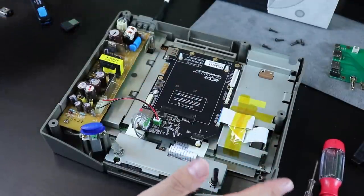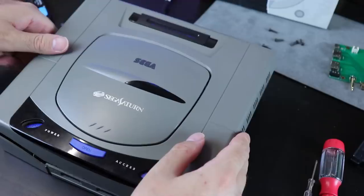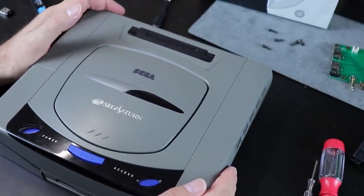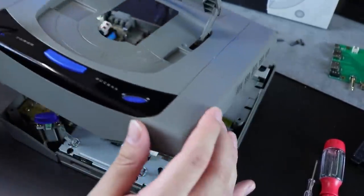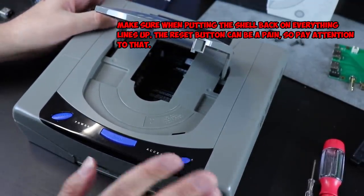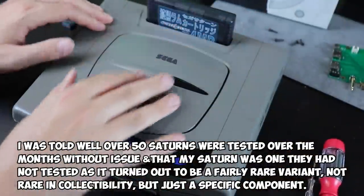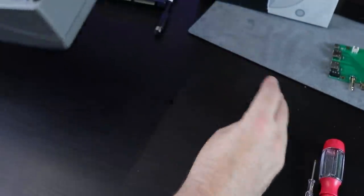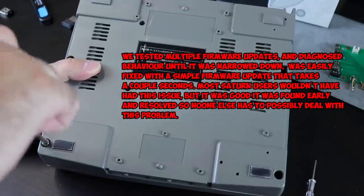Once I got this all going and tested out, I ran into some issues — but these issues have been 100% resolved. There was a lot of frustration, and it had to do with that ribbon cable. Once I set up the Sega Saturn, the MODE 99% of the time would not boot up. I removed it, tried it on the Dreamcast, and it worked 100% every time. The reason was the Saturn I have is just a slightly different variant with a different optical disc drive and ribbon cable, and the original firmware couldn't handle that — there were timing issues. That has been resolved. The team helping me out asked tons of questions, got pictures and video from me, troubleshot it, narrowed it down, figured it out, and got it fixed. So now my MODE on the Sega Saturn is 100%.